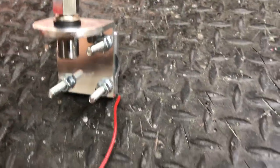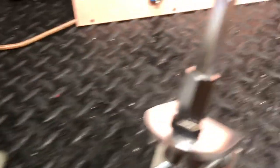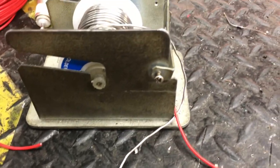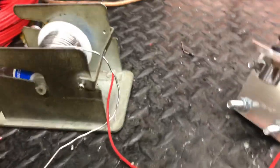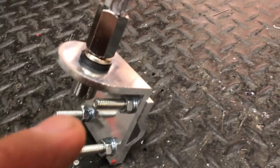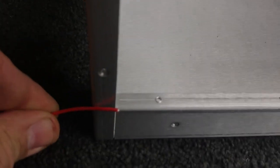Let's talk about how to do this properly. You want to use as short a piece of wire as possible. Hook it to the bracket and go to the first piece of metal — closest piece of metal from the bracket. Then come off that piece of metal with another short ground wire and go to the next piece of metal. The way you do it is: bracket, wire, metal, wire, metal — chaining as much as you can.